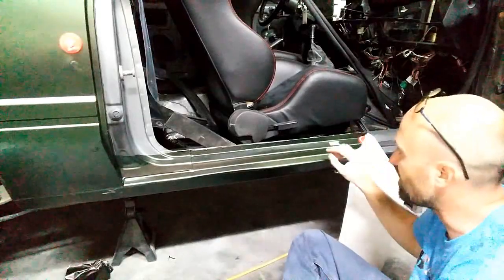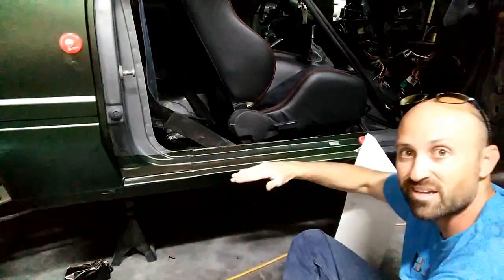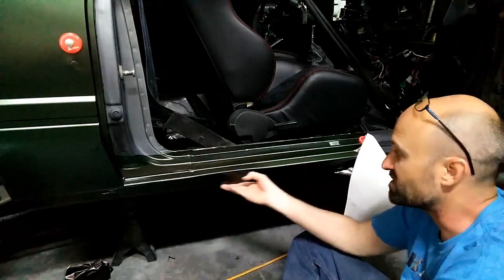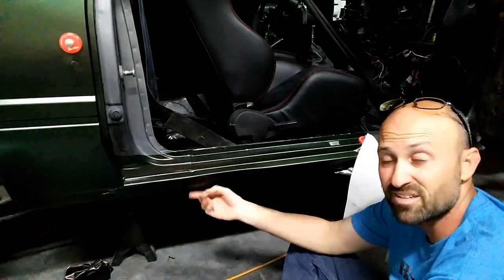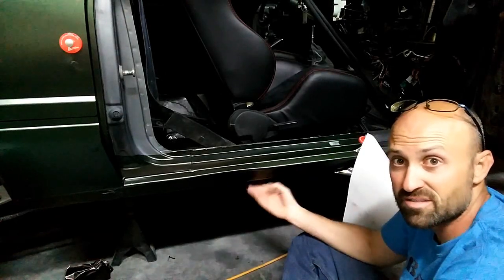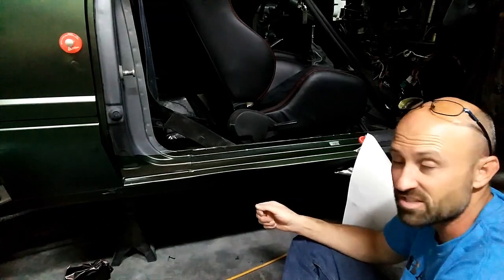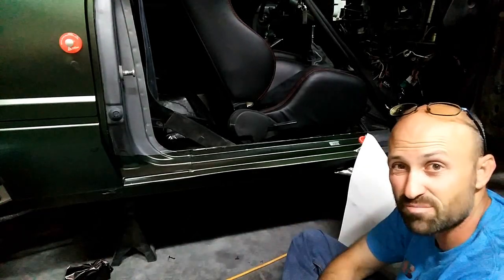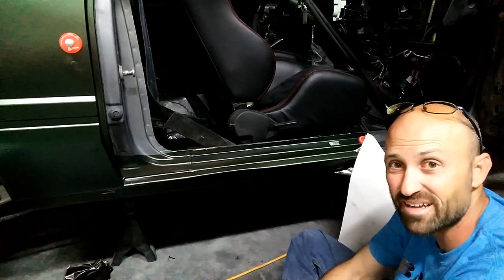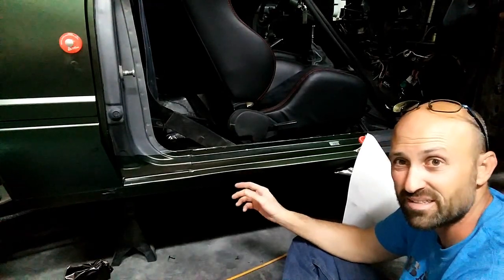But just remember, treat it like a waterfall. Start at the top, next layer, next layer, next layer, all the way down. And then when you get to the bottom, you can wrap it underneath. And again, you're gonna heat it, you're gonna seal it, and then tape seal it, because this area especially needs extra protection from peeling, just from any water splash, bugs, dirt, wind, anything like that. It's gonna try to peel at that vinyl wrap. So you wanna get that done.